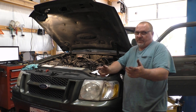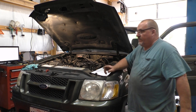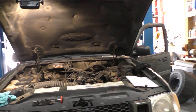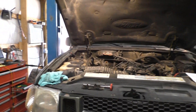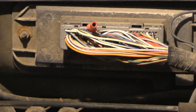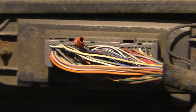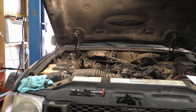Since the information was right there to be had, I went over to the computer and back-probed into the computer harness. I wanted to make sure that there was no signal going into the computer, and there wasn't.